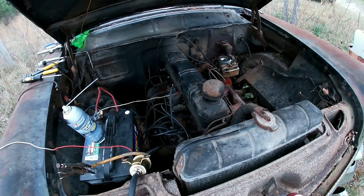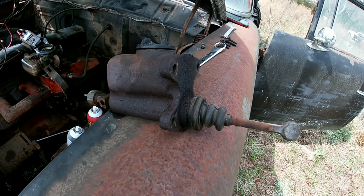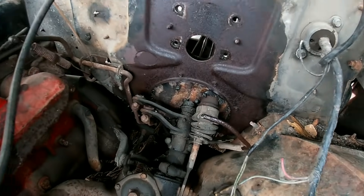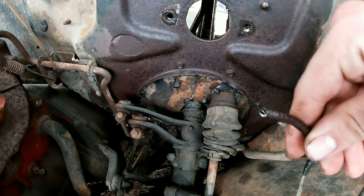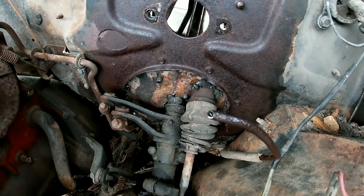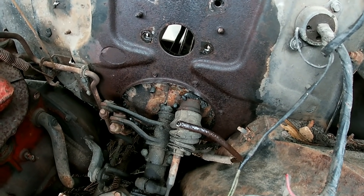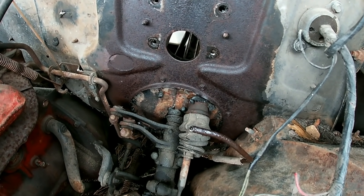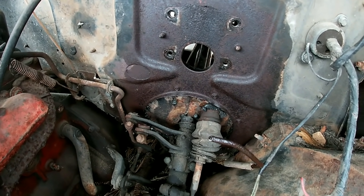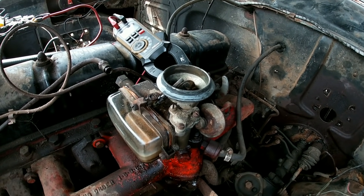That's where I'm leaving it for today — we're going to get back at it tomorrow. Alright, so I got her off and lo and behold, that brake line is going to break. We're going to have to get a new brake line. We did get her to run, so that's always good — we know she runs. Let's get some brakes and see if we can get it idling properly. I ordered a rebuild kit for the carburetor — it's pretty neat, it's got a glass bowl so you can see the fuel level.